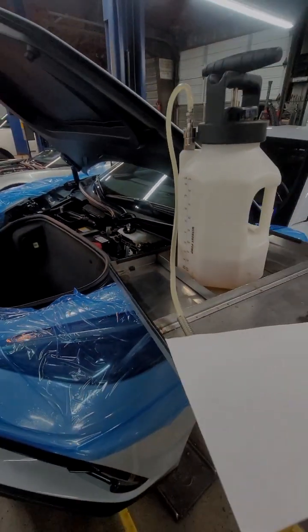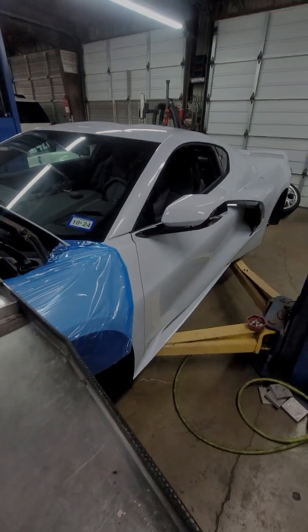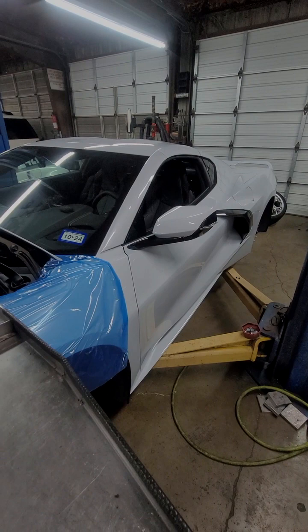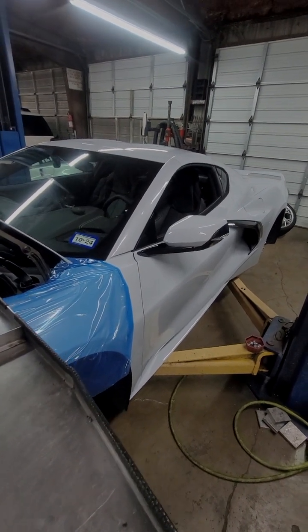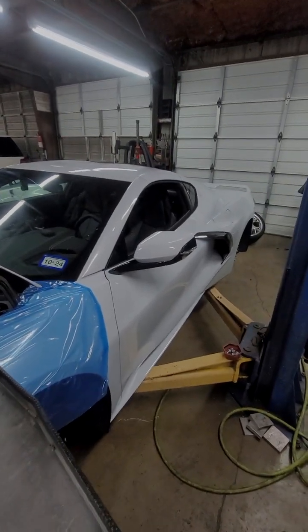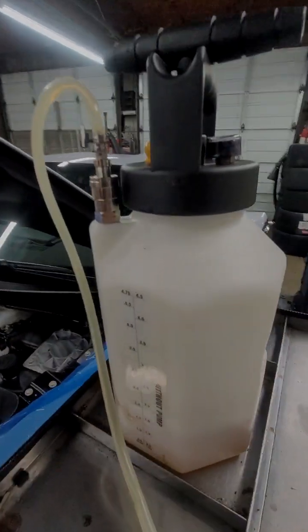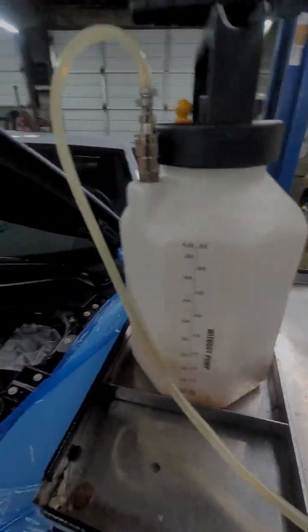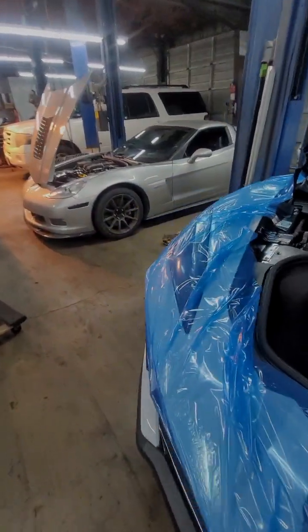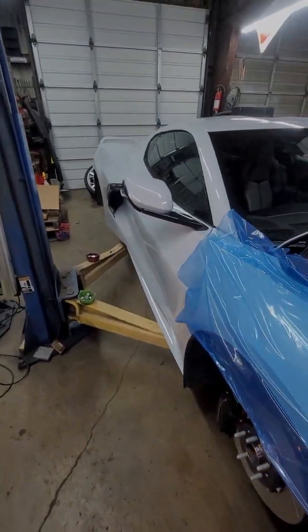Then you're going to connect the GDS to the car, go into the brake system, and deactivate the brake booster system. Once that is done, you're going to disconnect the negative battery terminal. You're going to attach the brake fluid pressure kit to the vehicle. You're going to bleed the right front, left front, right rear, left rear.